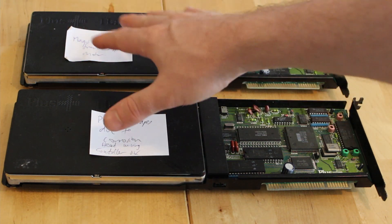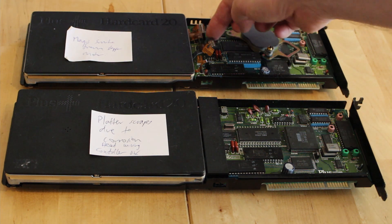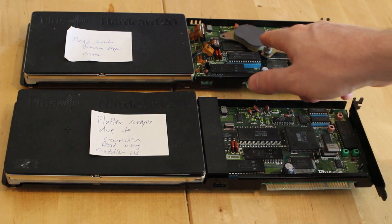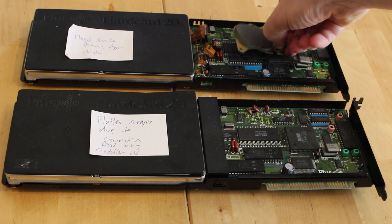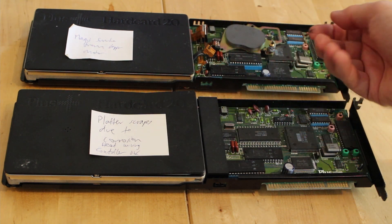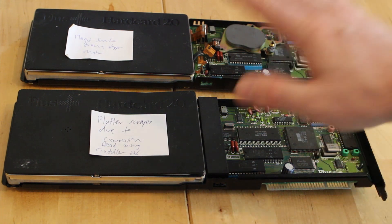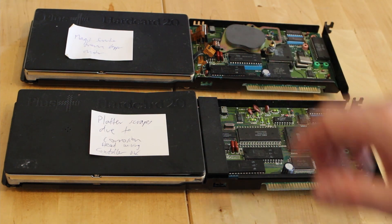The controller here probably also doesn't work — it flutters the heads even when you put it on a different drive. I have heard that the EEPROMs on these go bad with time, so that might be something to look into. But in my experience, all of the drives actually die before the boards, so getting a working controller is easy — getting a working drive is almost impossible. I've even disconnected one and removed the head assembly. You can see that central pivot point where the rubber stopper normally sits. This black goopy stuff is really disgusting — it gets all over everything inside the drive. That's basically the main problem these drives have as far as the heads are concerned. This needs to be replaced. Anyway, I'm going to open these today and look at the third one, the 40-meg drive, and try to get to the bottom of what else goes wrong with them.